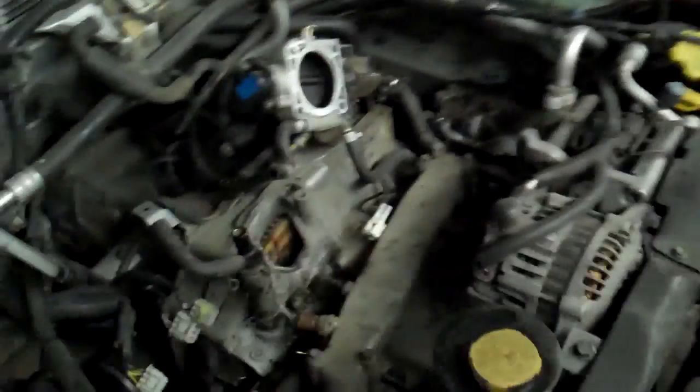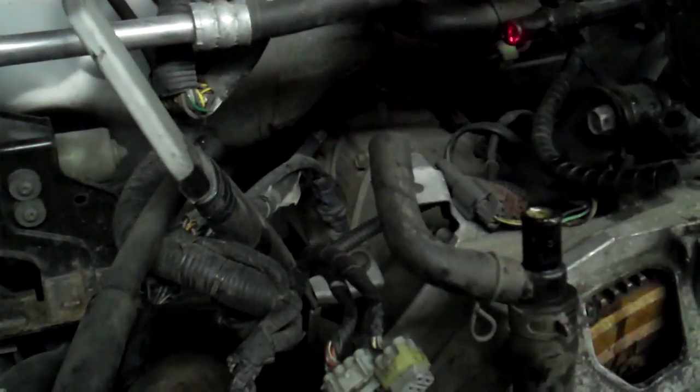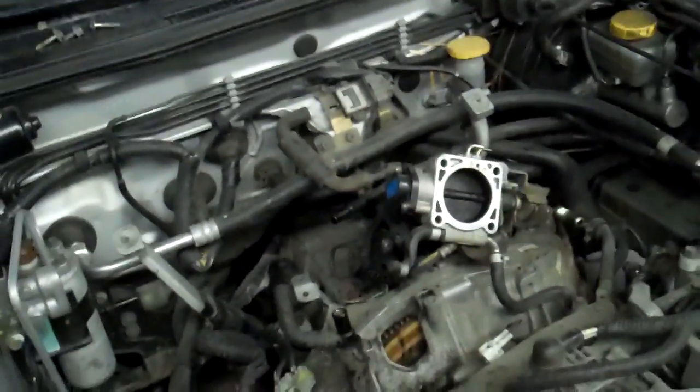I come around here and think, oh, I know what it is — it's the oxygen sensor wiring, because I've seen that before. There's a wire that runs down in front underneath the CV axle; sometimes those will touch, rub, and short. And there's another one that runs up over the top of the transmission for the other oxygen sensor after the cat. I check that — it's fine.